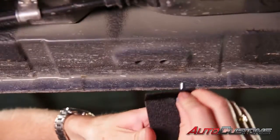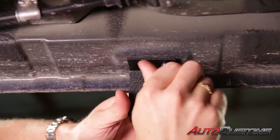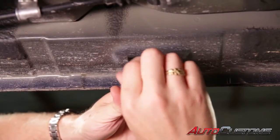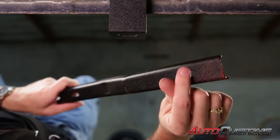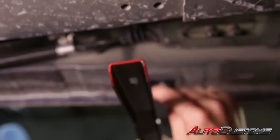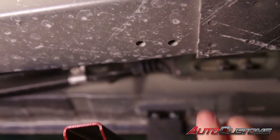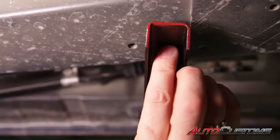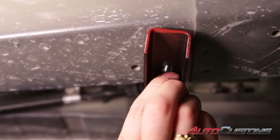Now we're going to go ahead and install two 8 millimeter bolts through the bracket brace into these threaded holes. We're going to leave it somewhat loose at this time, not tighten up completely. Now we're going to take our main bracket — we've got that oval-shaped hole towards the red painted end. We're going to come up on the frame directly behind the support bracket where we'll see two threaded holes. We're going to use the threaded hole closest to the front, running our 8 millimeter bolt through that oval hole in the bracket and putting it in hand tight to the threaded hole in the frame.